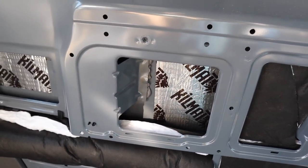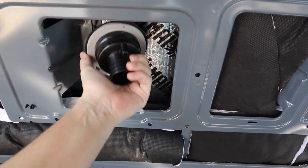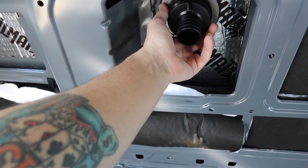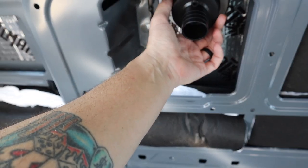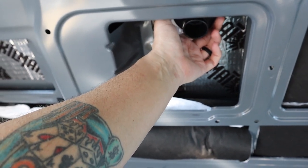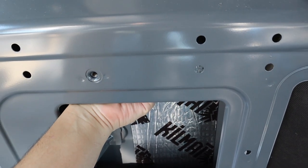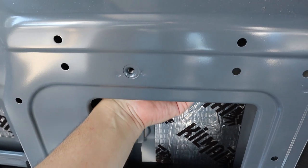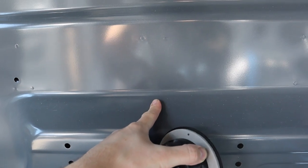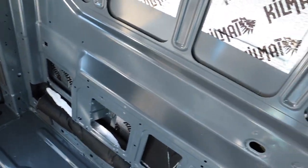I was planning on mounting the water inlet in this space right here, but the problem is we don't have our water tanks yet. I can pretty much guarantee they're going to be taller than where this is located. This is a gravity water inlet and it needs to be mounted above your water tanks — ideally significantly higher. I could cut out this rib and mount it a bit higher, but that's still not a lot of space, and drilling through all this stuff isn't ideal. If I go through all that work and it doesn't end up working the way I want, I've got this hole in the side of the van and I'm basically stuck with it.